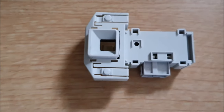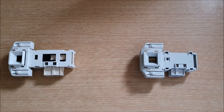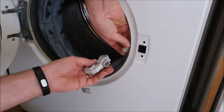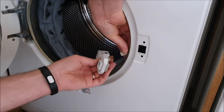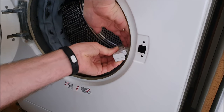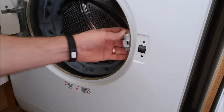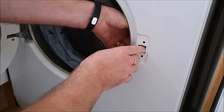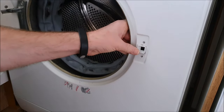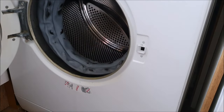This is the old switch and this is the new switch that I purchased online. You can see the new one is slightly smaller than the old one, which was about 18 or 19 years old. Got my new switch, got the electrical connector trying to line up with the clip on the back - that's just clipped in. Then slide it in; the lip nearest to the door opening goes in first, and then just got to line up those pips. And that's that done - the new switch is on.